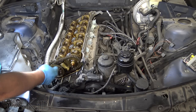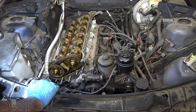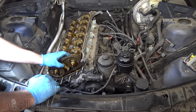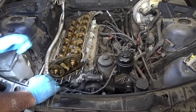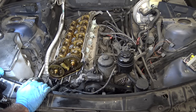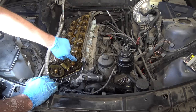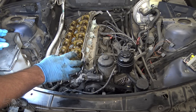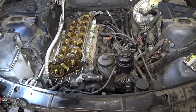The next step is to remove the timing components. We've got six nuts — three here, three here — they're 10-mil nuts. Then there are three E10 Torx bolts. Then we need to remove the timing tensioner — there's a 10-mil here, two right here, and one right here. That'll remove the tensioner. We'll also need to remove the guide. I highly suggest carefully removing these sprockets together with the chain and just keeping them in the same orientation. I'll show you what to do. I'll take off these bolts and the cover plates and then show you.